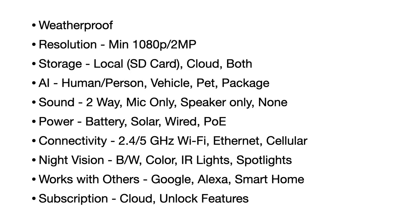For connectivity, most cameras run on Wi-Fi. Some run on dual-band Wi-Fi — 2.4GHz and 5GHz. Some plug directly into your ethernet network, and there are even a couple we're going to show you that come in a cellular version if you don't want to be tied to your internet connection. Don't be afraid if a camera only has 2.4GHz — 5GHz gives you more bandwidth but 2.4GHz gives you more range. Depending on where your router is, you might need that 2.4GHz, so having both gives you the best of both worlds.